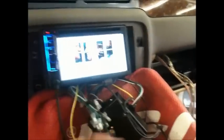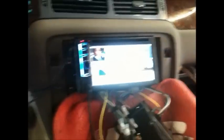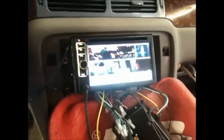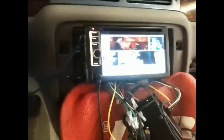But since we're not using either or, we're using our own, we're going to run our own RCAs and then amp up the speaker wires directly from our amplifier, there would be no way for the OnStar or any of those goodies to be able to talk or for you to send commands out to OnStar or for it to talk to you. So what you have to do is tap down here